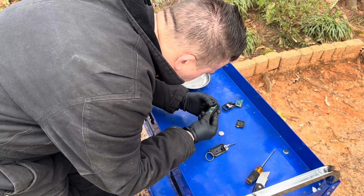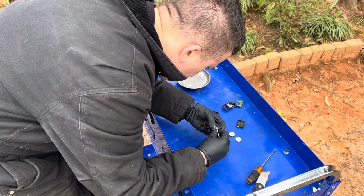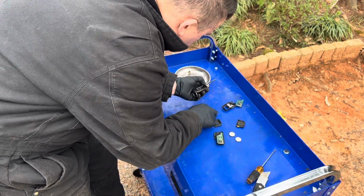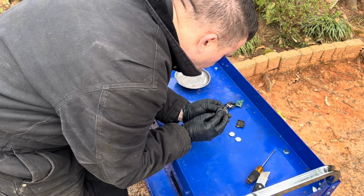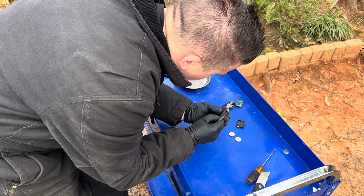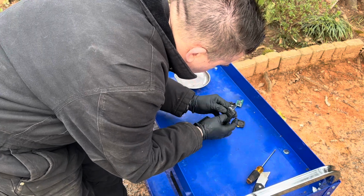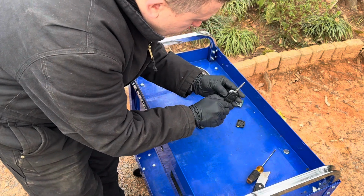But anyways, I went and checked that key inside, plugged it in, and it wasn't even spinning. So I'm thinking, okay, good, I caught it before I installed the wrong key into the key fob. Well, I guess by doing that, I caused a start error just by inserting the wrong key. Now, a simple fix, which may or may not work, would be to simply disconnect the negative battery cable. But of course I do have a computer that can basically do its thing for the immobilizer and hopefully get it started. So that is one of the options that I have, maybe the option that I will take.